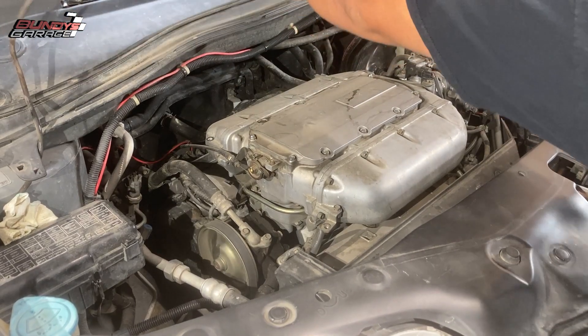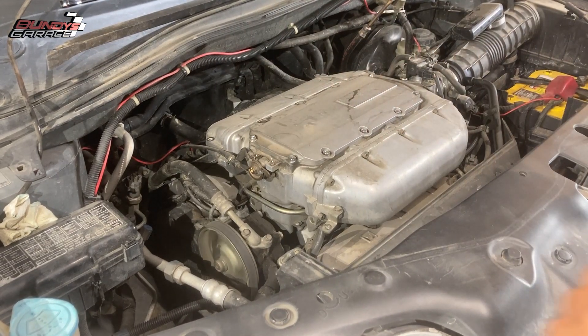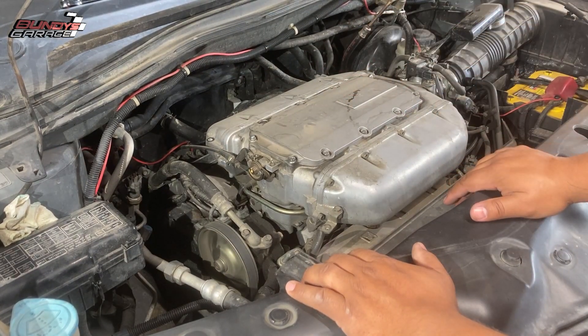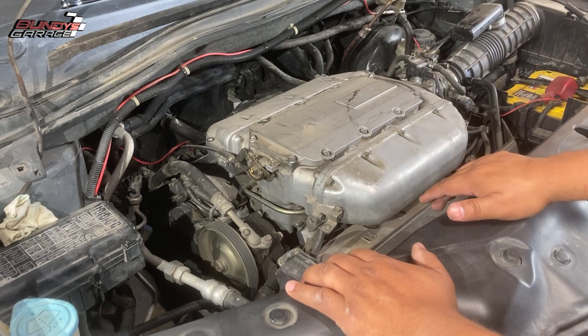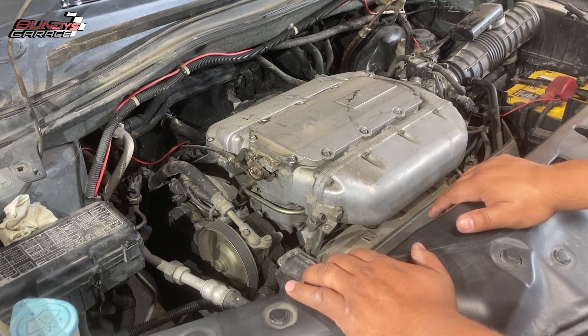So the upper intake plenum needs to come off, the upper intake manifold needs to come off, and then pop the back valve cover off and readjust the valves. It has to be done when the engine is cold, so I'm going to have to wait overnight to do this. But I'll get everything prepped and ready. Leave some comments down below whether you want me to show you another valve adjustment video.